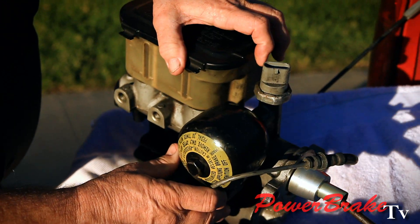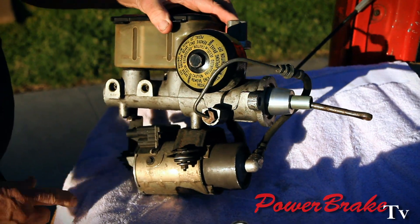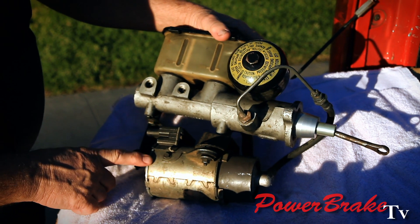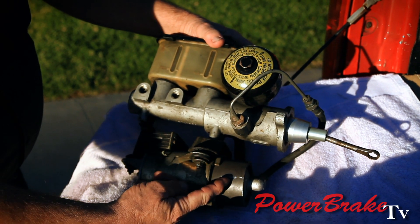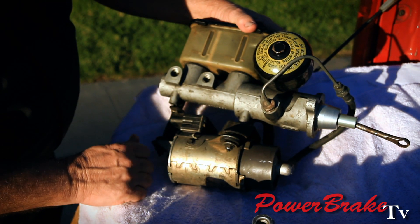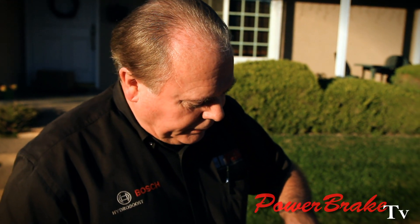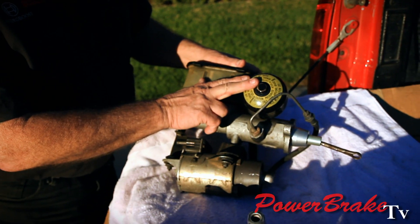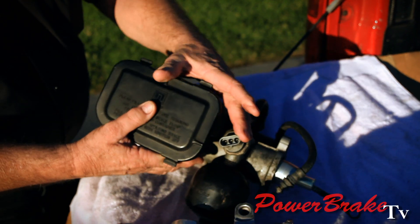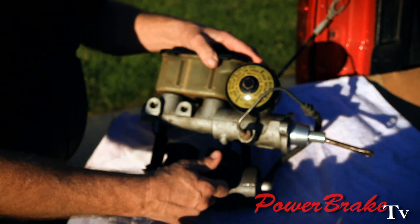But the problem with this is after 10-20 years, the electric motors go bad. They start seeping brake fluid under high pressure into the electric part of the windings of the motor, shorting it out, or the vanes wear out in the pump. So we have three issues with this system: the motor goes bad, the accumulators go bad, and the pressure switch goes bad. These become an issue of changing these things every two or three years.